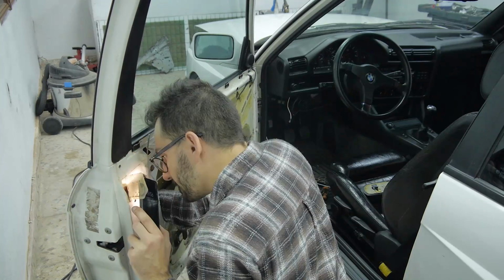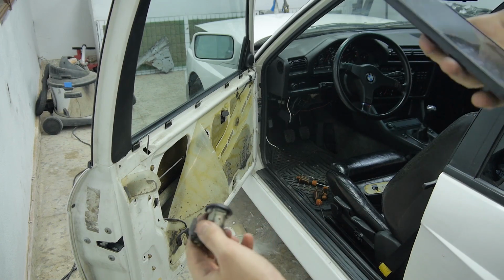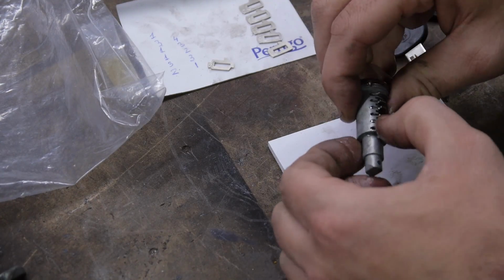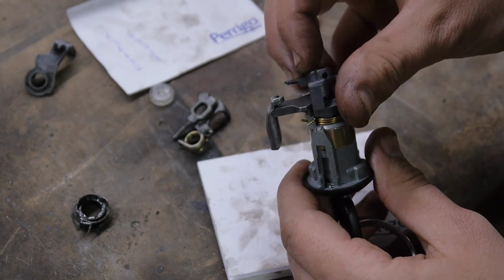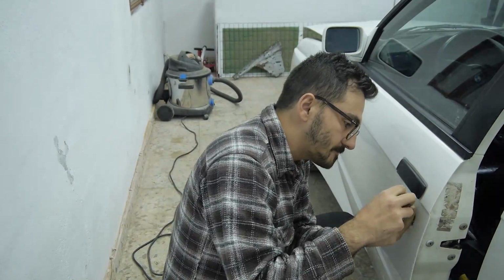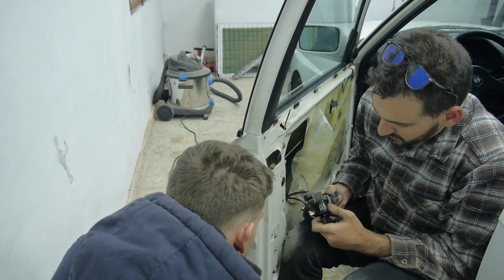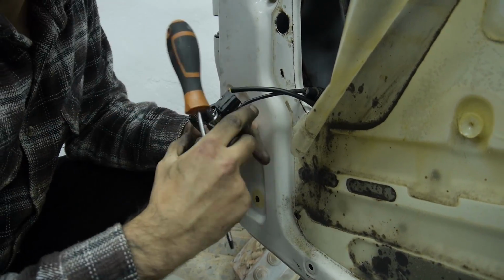Once inside, the lock was wiggled out of its position and onto the bench for a rebuild. With a new lock set from BMW, the new tumblers were fitted into a new cylinder in the correct position along with the rest of the new parts and grease from the kit. Once it was fitted, it became clear that it wasn't the problem. Although much nicer to turn, the lock still wouldn't activate the passenger door or boot.